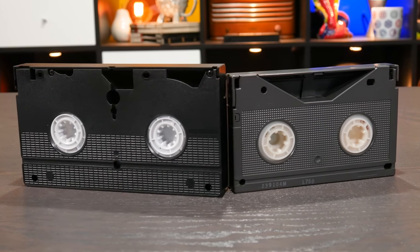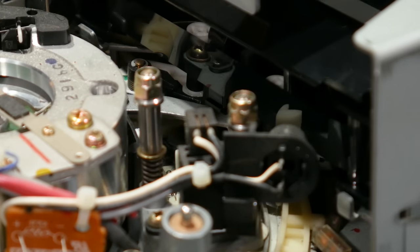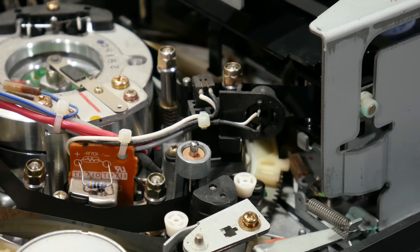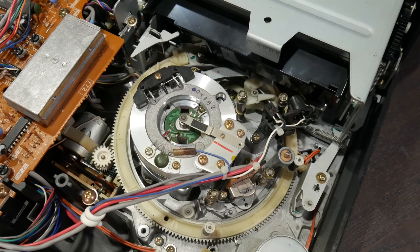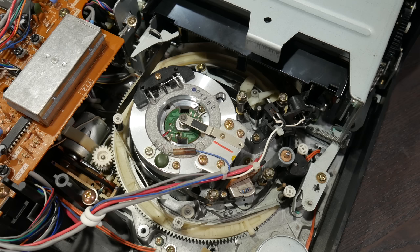First is, this explains why the hole on the Beta cassette is so frickin' big, as the rather large pinch roller and those tape guides all need to fit behind the tape in that space. And second is that once the tape has been removed from the cassette, none of the tape transport components are very close to it at all. Sony designed the Beta cassette as just a container of tape. The machine removes it from the box, and from that point on, it might as well not exist.